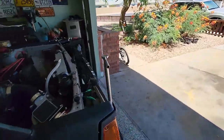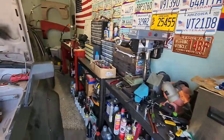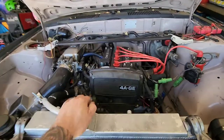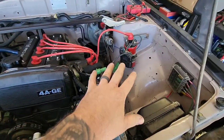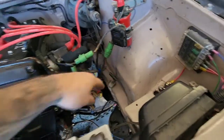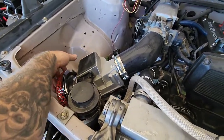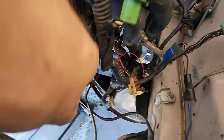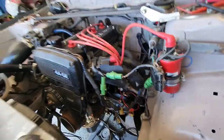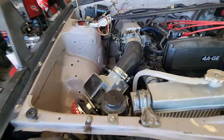I'm going to bring you up to speed on where I'm at so far in this swap. Things always go crazy when you're doing a swap. From the last video, you can see the engine's in. This is all just nuts and bolts — just a coil, got that set up, plugged into the harness. MAF and then intake. Got a little cheap air filter. I put oil in it. I actually had to remove my oil cooler because with the cooler it was hitting this header. So I pulled that out and just put a little pipe adapter in there.